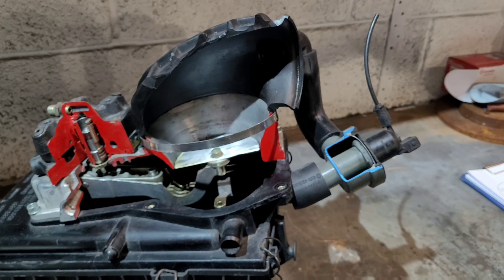The next video is going to cover the idle stabilization valve — I'm going to cut one apart. In a typical driving scenario: steady state at 3000 RPM, you lift off the accelerator, this valve system pushes down and cuts fuel off. The engine, with no fuel and no air, slows down and the revs drop in a controlled manner. Once they get to below 1300 RPM, the idle valve takes over and this valve returns to its dormant state.